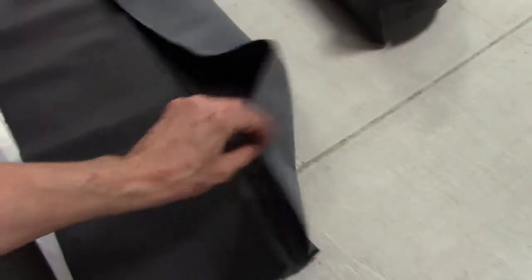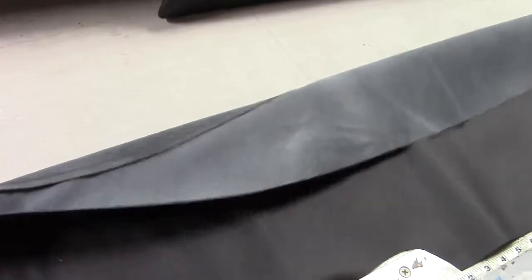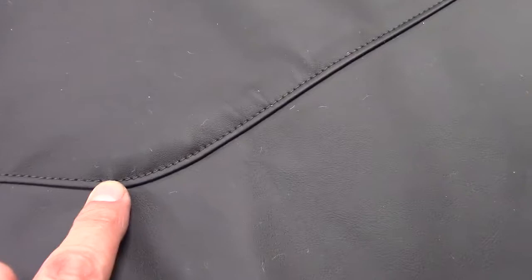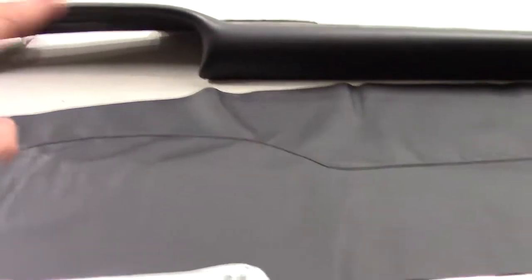That's approximately half the thickness of the original. So instead of 1.1 to 1.4 millimeters thick, it's less than half of that. It becomes very thin, as you can see. So this is put through a giant plane, the suede is taken off the back, and it becomes very thin and pliable. It's also important that it's cut with the grain direction of the animal in a way that helps the trimmer for the bend, for the irregular shapes. It's then sewn together and beautifully decoratively top stitched, as it was from Porsche, and that's the beginning. Now getting that onto that is a whole other story.